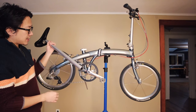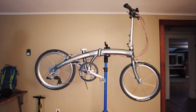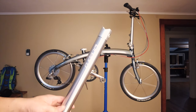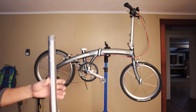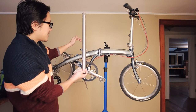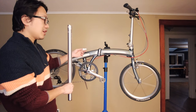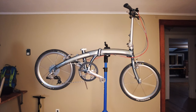With a lot of Dahon folding bikes, the seat post size is actually quite thick and quite long. Fortunately I was able to go on eBay and find a perfect replacement, which is this one. It's made by a company called Light Pro, a very popular Chinese brand. They sell not only aluminum seat posts but also a slightly lighter carbon fiber seat post. The thickness is 33.9 millimeters, which is the right size for a lot of modern Dahon folding bikes.